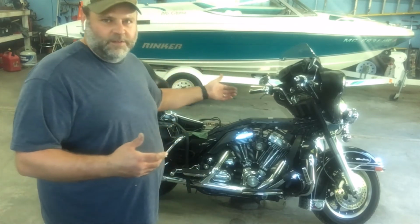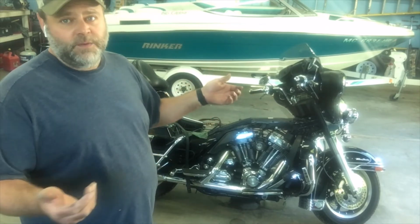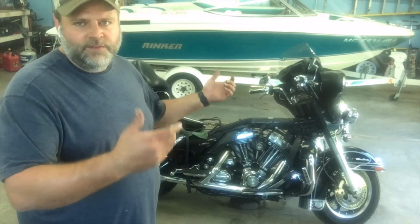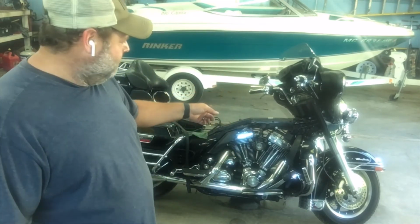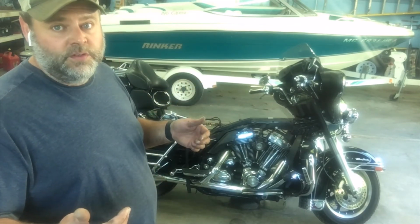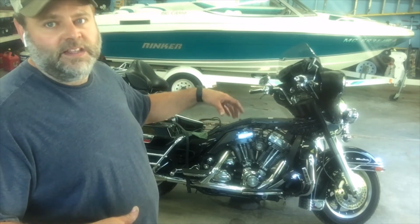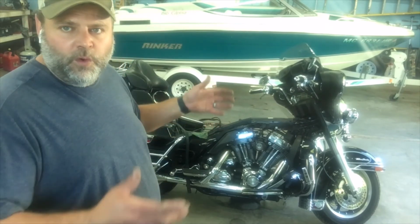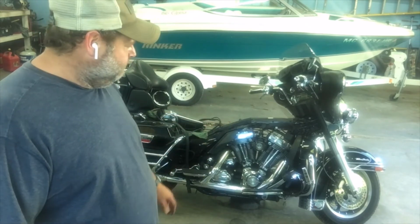I mean, the block trick underneath the gas tank didn't work necessarily on this bike. It may on a different one. I don't know. But on the Ultra Classics, the tank just had to come off. I will note though that that top motor mount brace there still has to come off in order to get at that screw. So once you get the tank off, you will have to take that bolt out of the brace. I do have a jack on the other side of the motor, holding the motor steady with that brace off there.